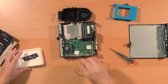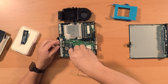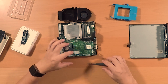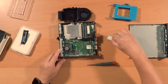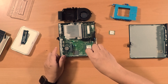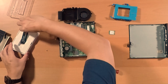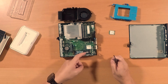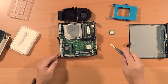First we have to take the 256GB SSD out. I'm going to unscrew this — it's a very special double screw. It's good to have a magnetized tip. Let's bring this up, wiggle it out of the slot, and unscrew it one more time then put it in the next slot. Now we're going to put in the new memory — it's a 1TB drive. Put it in the slot, push it down, then screw it in to secure the chip. Perfect — and that's it.